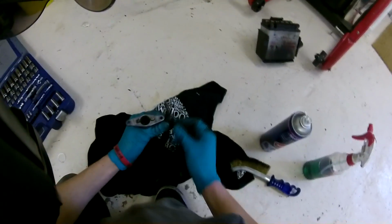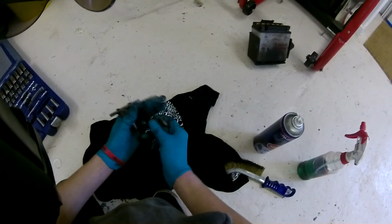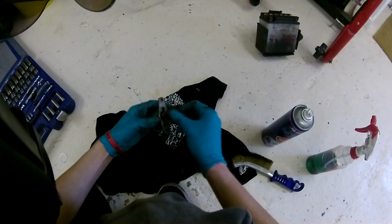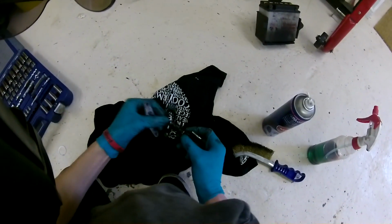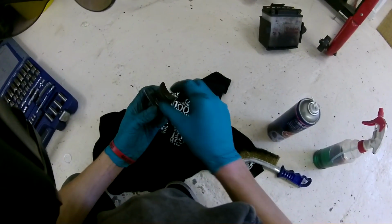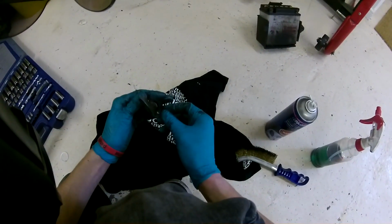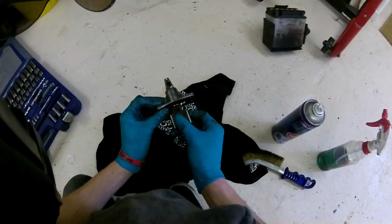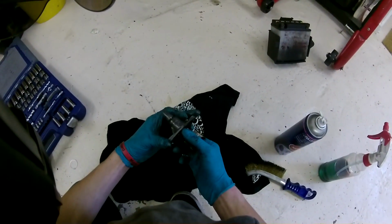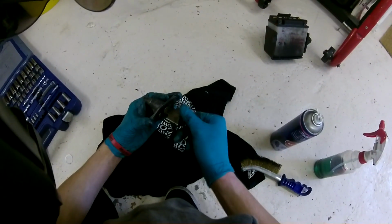It just sits on the bottom there. Then your spring goes on top of the shaft, and then the Powervalve goes inside the housing like that. But you need to put your gasket on. So it goes like that really. It doesn't matter which way the housing is facing, whether you have the housing facing like this, or like this, but what does matter is which way the blade goes.